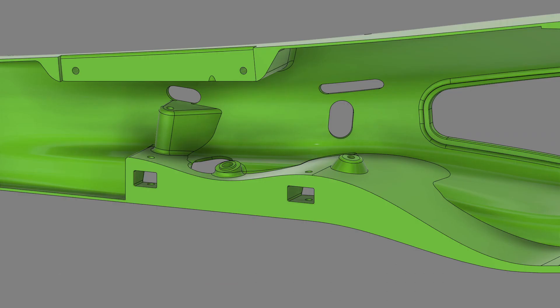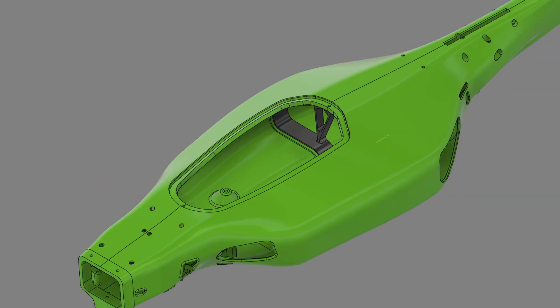The suspension mounts were fairly straightforward but required a lot of playing with the design. Everywhere there's a hole in the monocoque for either a suspension arm or for cooling, I had to thicken the area around the edge of the hole to add additional strength, because 3D prints when they're only a single layer thick will easily crack at that point. A really important part I learned from my streamliner design is adding a hole in the monocoque above every screw so I could get a tool inside from the outside to actually install the suspension. The holes are very small, so they're really not of consequence to the structure or the aerodynamics.